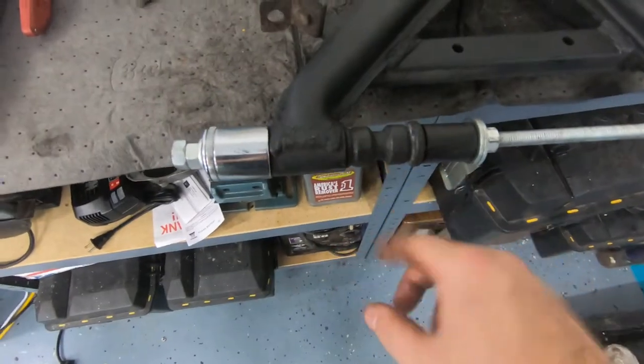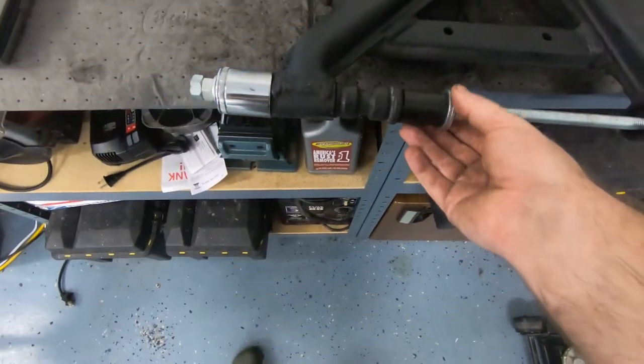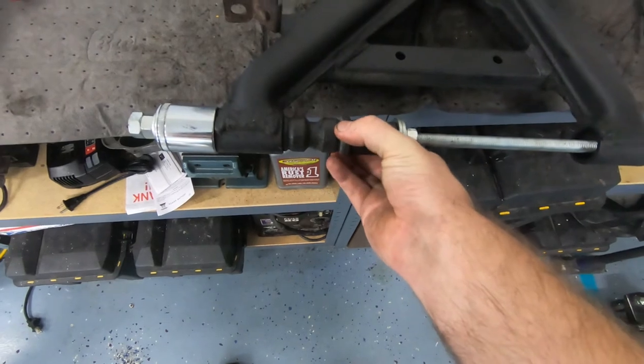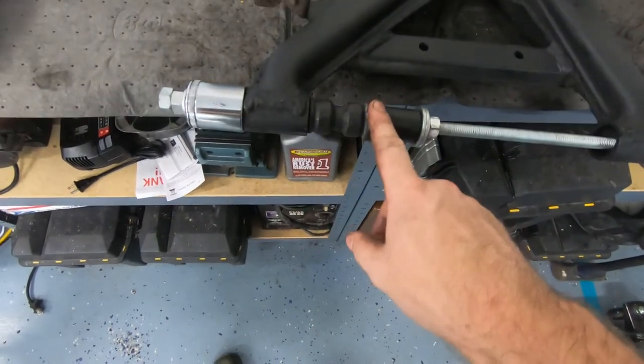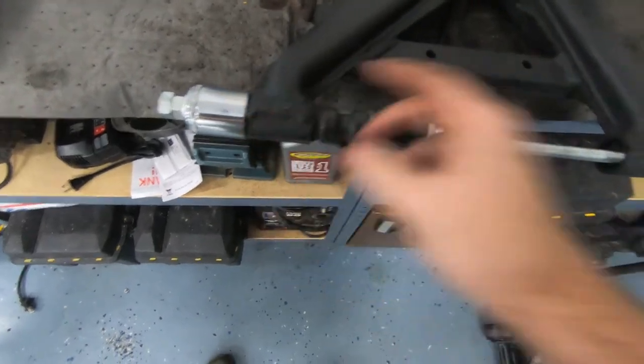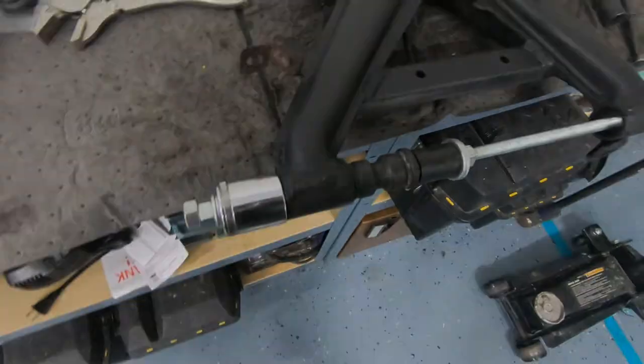Here we're pressing the RTABS back in. Same rod as before that we took it out with. Just got a smaller socket on the wide side. Actually, I just realized I set this up backwards. This wider side is supposed to be to the outside on both of these ears. So let me flop that around, and then we'll get to wrenching.